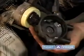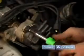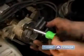Just for the sake of discussion, we're going to assume that I'm replacing this with a new part. The installation procedure is pretty much the reverse of the disassembly procedure. We're going to slide our new distributor cap on, then run our screws back down or reattach our bolts or clips, whatever happens to be the particular mounting style for your vehicle. It's a good idea not to over-tighten these screws.